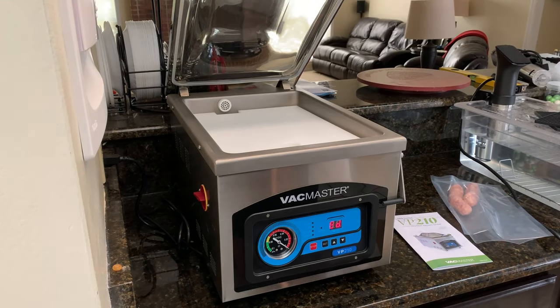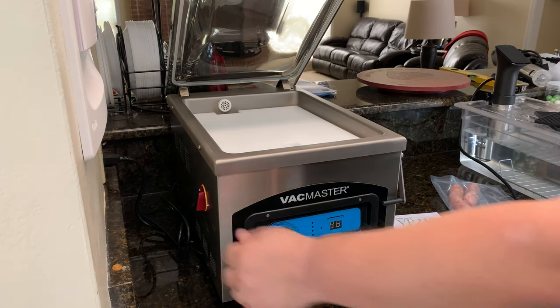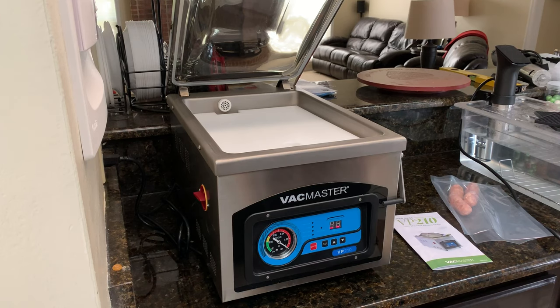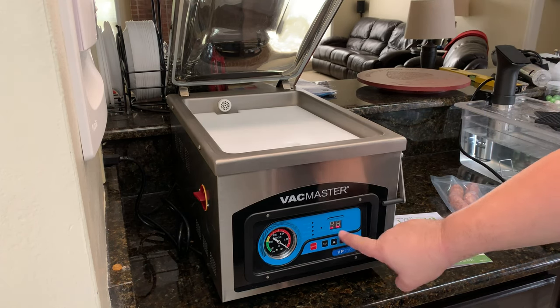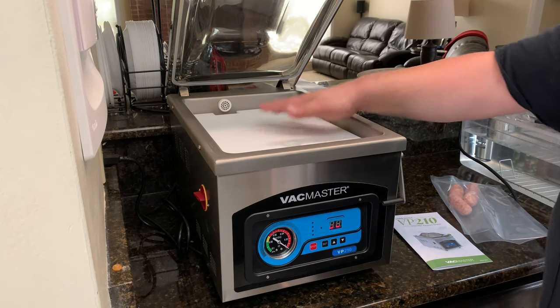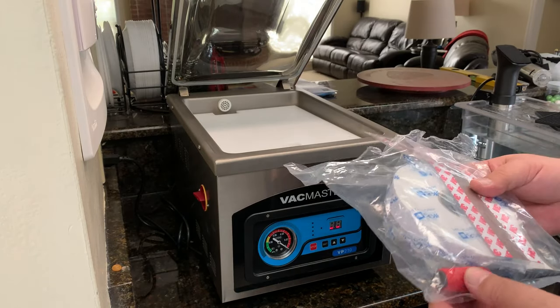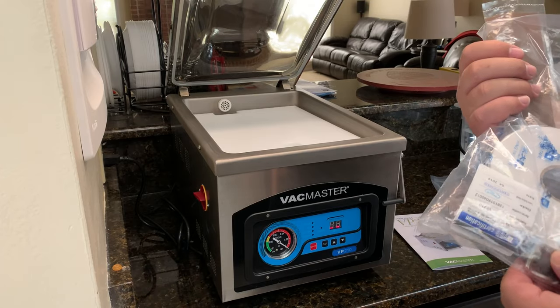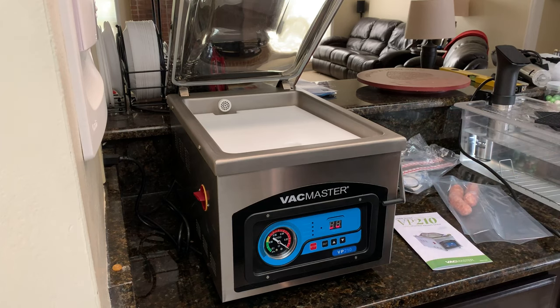I'm going to put this right where I had my old vacuum sealer. When you plug it in and want to turn it on, there's a little knob right here on the side — it's a big red knob. Up is off; if you turn it down towards you, it turns it on. One thing you're going to want to do when you turn it on: make sure your lid is open, because this is set up to run automatically. So your lid is open, you see these two dashes, and everything's ready to go. I'm going to keep my spacer plates in here for storage. Make sure you hang on to that bag of accessories — the replacement seal bar parts, fuses, and tools. Just keep them in a bag and make sure you remember where they are. Don't lose them, don't throw them out.